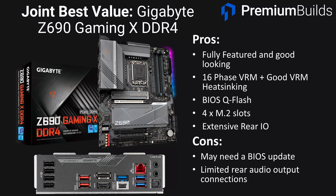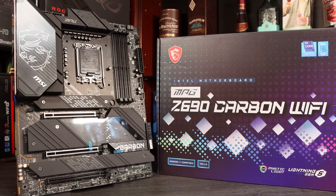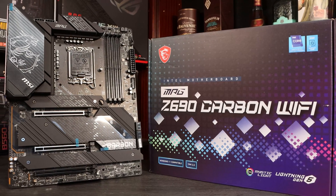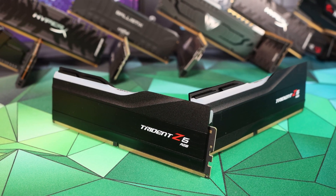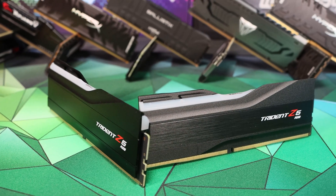Stepping down in price from $200 and up, you've got the MSI A Pro, the Gigabyte Gaming X, and UD motherboards — they all offer virtually the full feature set of the Z690 board, just with some slightly cheaper components and slightly lower-end looks, but they're perfectly functional, very good motherboards. If you're looking for a great value option, I'd certainly consider those in place of the MSI Tomahawk. Going above this motherboard and looking towards $400, we start to approach motherboards that are basically DDR5 only. It's a shame that all the manufacturers have opted to make their high-end boards DDR5 — that RAM is incredibly expensive at $300 and up and very hard to find in good specification. Those high-end motherboards don't offer significantly more functionality than the Tomahawk, but they nearly double your platform costs just to get a PC up and running.